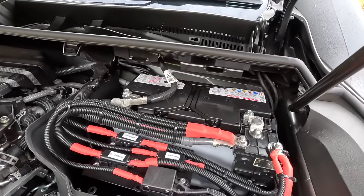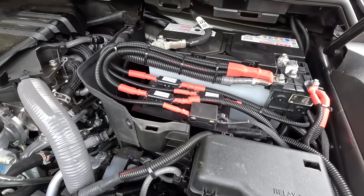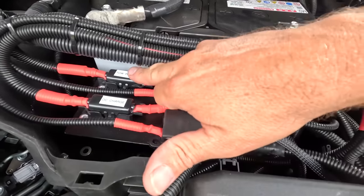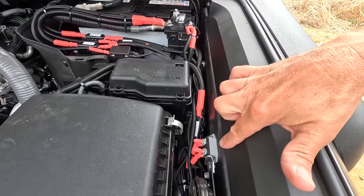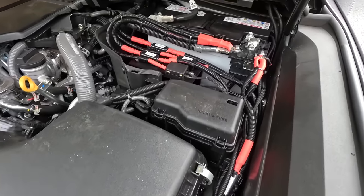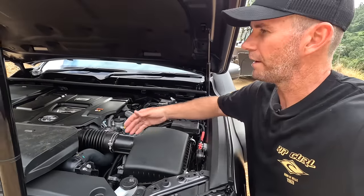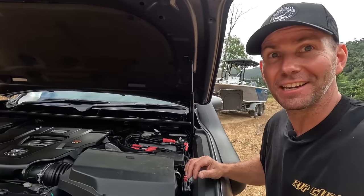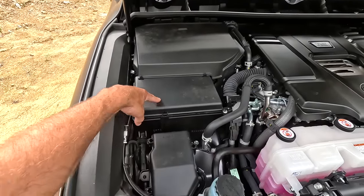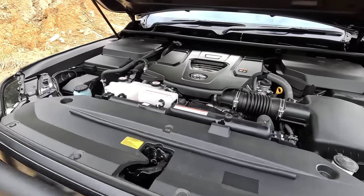Pro Touring have done their package in here with a basic tow pro, DC to DC charger, and light bar circuits — super neat, all zip tied, heat shrinked and labeled. There's a Redarc Smart Start VSR so you don't drain your battery. Everything's labeled so you can chase down any dramas. After three years of touring in the last rig wired up by Pro Touring I haven't even looked at a fuse panel — it just does the job day in day out. But god help me in this thing — there's fuse panels everywhere, under the bonnet and under the dash.